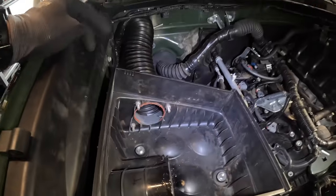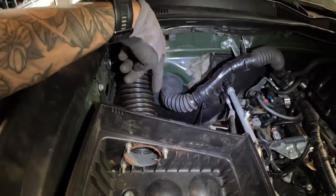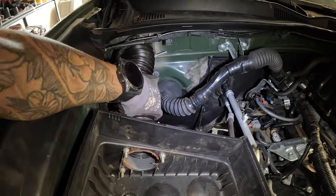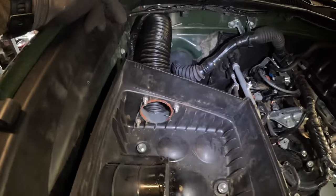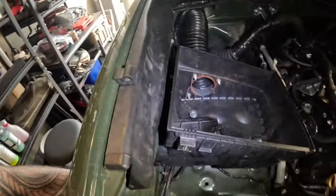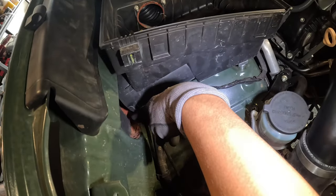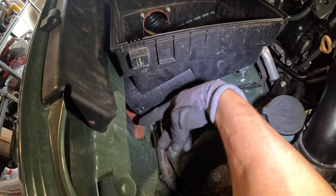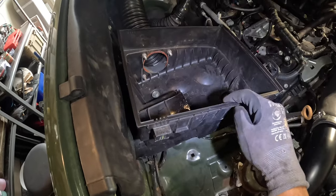So this is how it looks — typically the battery would mount here, but because I have my cowl intake mod, I'm relocating the battery over here. Before you do this, there's a little cup that redirects water into the fender well — make sure you remove that before reinstalling the air box. Now that's reinstalled, let's start working on the inlet tube.